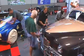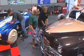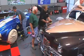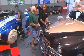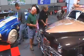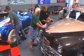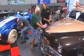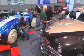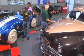What you don't want to do is spend your whole day polishing out a car and then run it through one of those brush-style car washes, or even one of the hand car washes, because those guys drop those mitts. When you pull in, they don't say, hey everybody, look, it's Wes and his Mercedes, let's get the good mitts out. They just use the same mitt they washed that dirty truck with. So I always tell guys they've got to take ownership of the wash process. A lot of guys don't want to hear that, because it's so easy to take it to a car wash. I blow it off with a leaf blower. I won't even use a chamois on it.